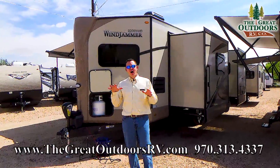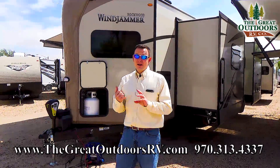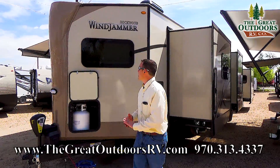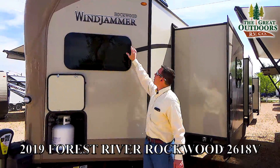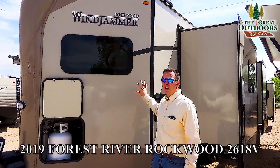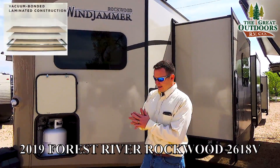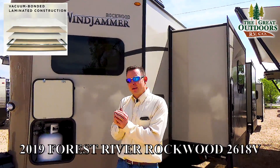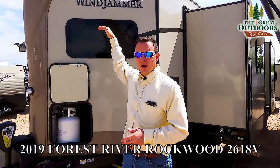To find out all the information about this particular camper, we're going to put a link down in the comment section so that'll have the latest price as well as pictures and all the specs. As far as construction, this is top notch. This is in their Ultralight series. They have the frameless windows, the Lamelux 1000. This is not a pinch rolled wall — this is a vacuum bonded wall, so you don't have to worry about delamination problems where the wall starts to separate.